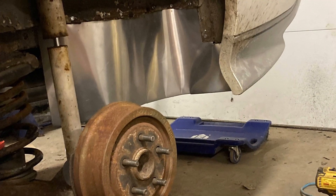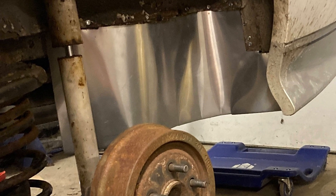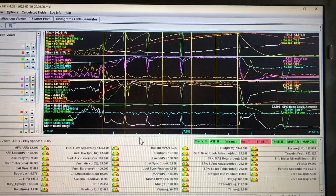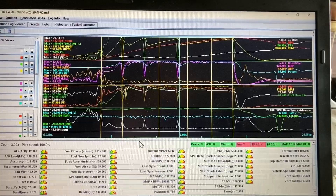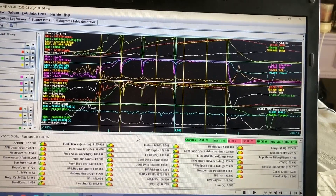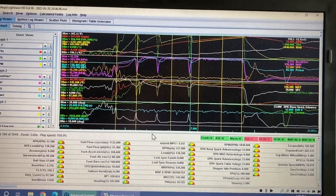I also built plates behind the wheels so air couldn't get in from off the rear tires and be thrown behind that plate, causing more of that parachute effect and slowing it down. I want to give you an idea on how I decided to do this aerodynamic testing — I didn't want to change the look of the car much, just keep it looking pretty much the same while making it a little more aerodynamic and see what effect it would have on quarter mile drag racing times.